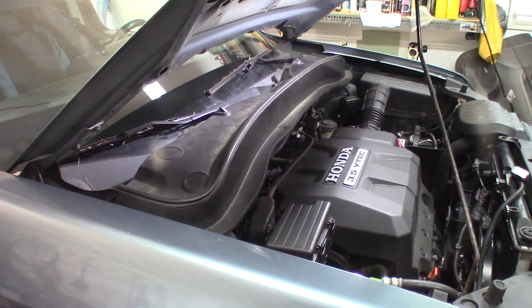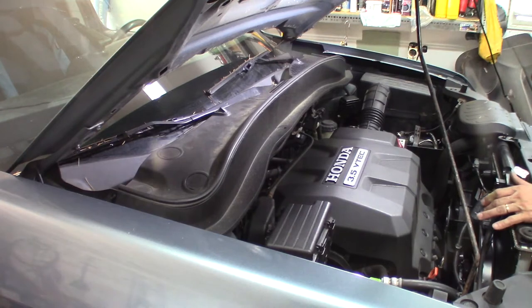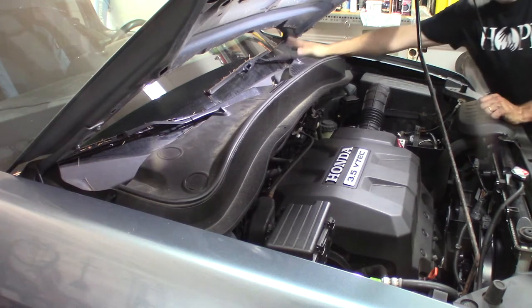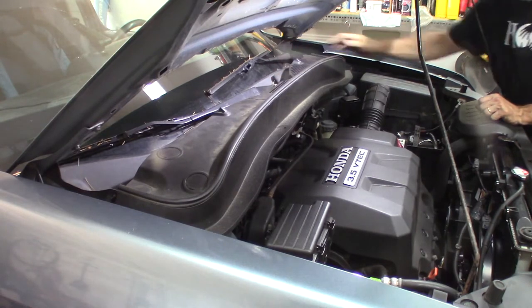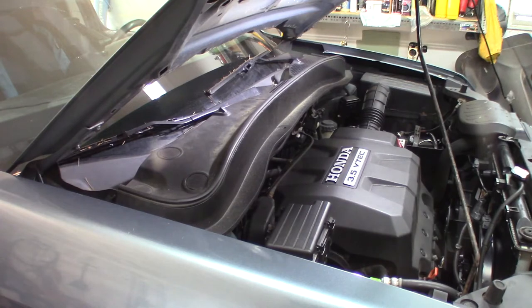First we'll just — these arms are just bolted on, there's a cover, a little rubber cap on them. Pull them off the wiper arms. The wiper arms are a little different: the one on the driver's side has a little angle as it comes up from the bolt, and the one on the passenger side is straight — so remember that. I think these are 15mm or 17mm, we're just going to zip them off.